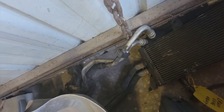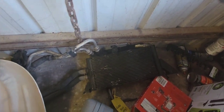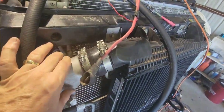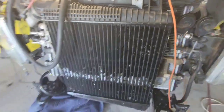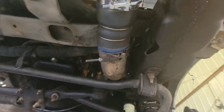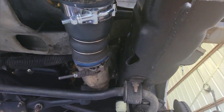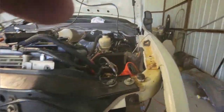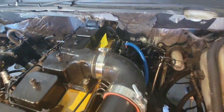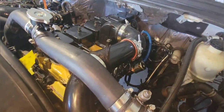That is the fuel cooler — I took it out since we're going directly into the riser pump so it's not needed. The air conditioner condenser is up here. I've got the intercooler and all the air intake piped in for the turbocharger — it's underneath here. It comes in up here and goes back in there. I used the old F-350 line coming up and then went with a new line I bought — it goes over and connects right there. I also have the coolant to sort out.